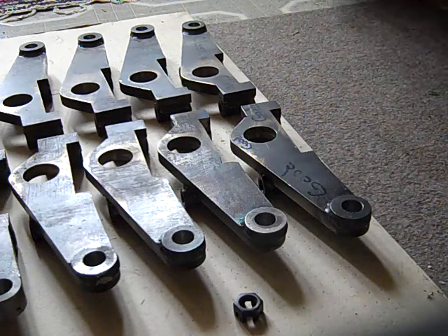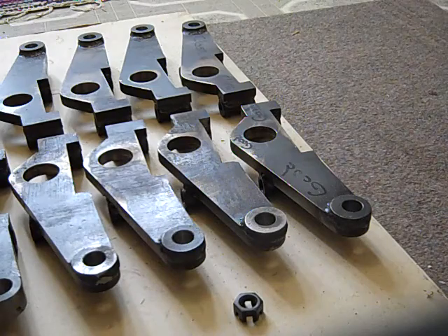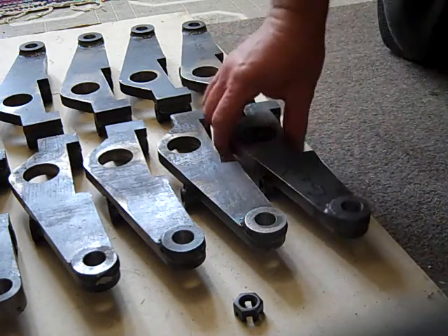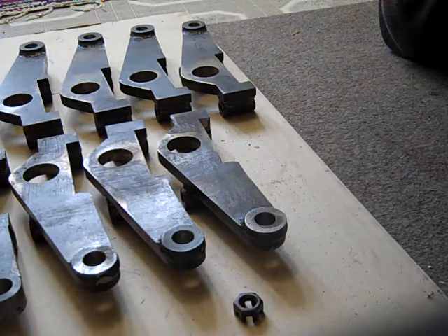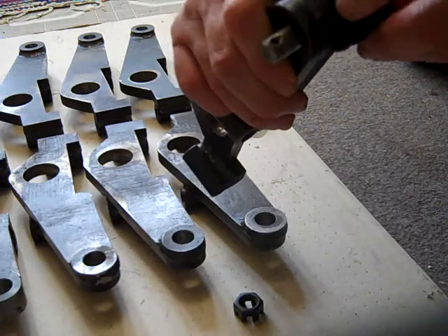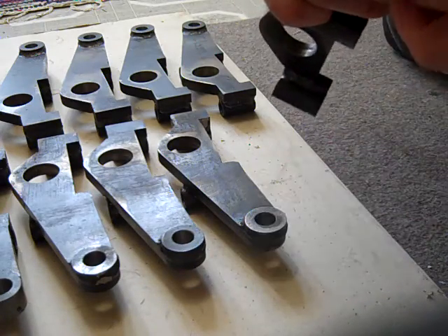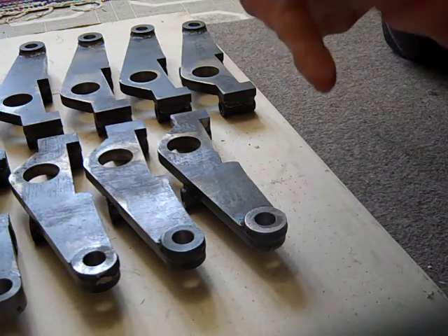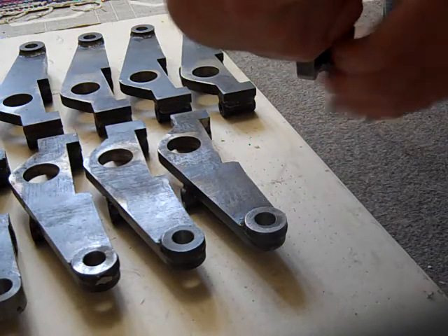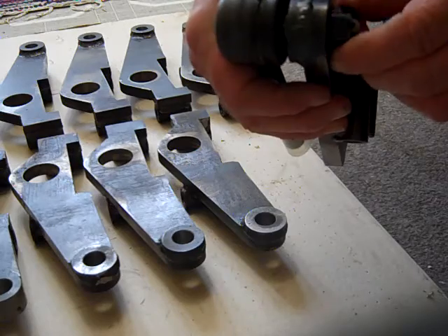Let me go turn the light on and give us a little light here. And I marked 'good' on this one, so you can see what I'm talking about. Now, when I drop it in, you can see the line. You can see the black line — it lines up. More importantly, what's nice is when you put the nut on, it lines up so that the cotter pin can go through. And that's what you want.